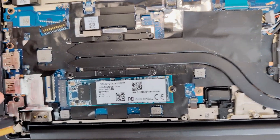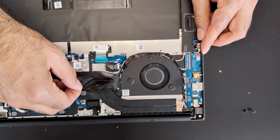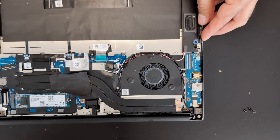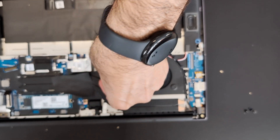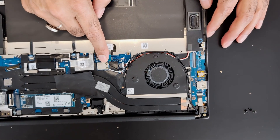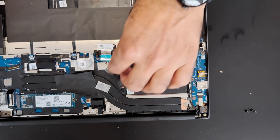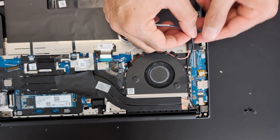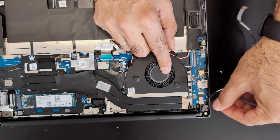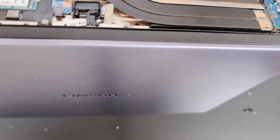Same thing here - we will need to remove the wireless antenna cables as well. So just remove this tape and attach it somewhere else. Also, there is another plastic thing on top of the wireless card. Just remember, the black cable is first and then there's the white cable. We will always take some pictures. Remove it slowly. Once that's removed, the screen should come loose. There we go - it's been detached from the base.